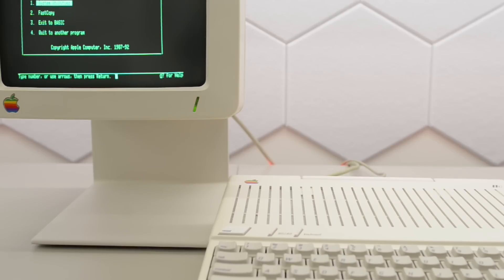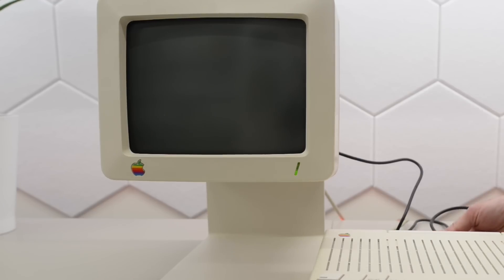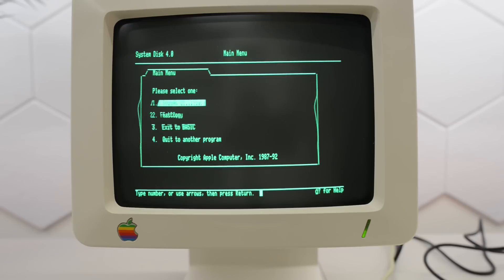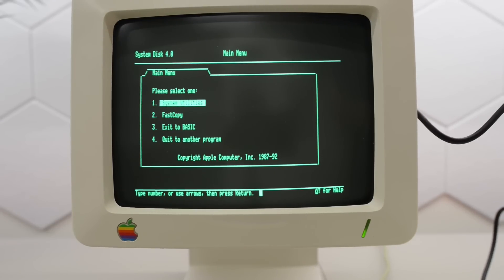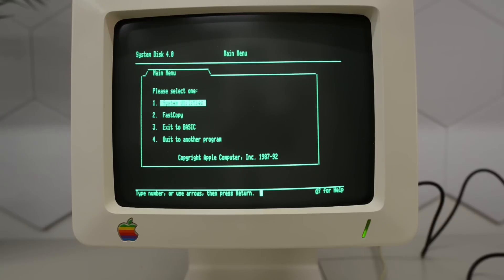Let's start with the simplest thing first. I noticed that the original display cable has connectors that look very worn, so I've got a brand new cable here — very nice and thick. Let's give it a try. Oh, that looks even worse. That's interesting. Now the graphics are shaking even worse than they did with the old cable. Let me twist and turn the cable and see if that makes any difference. No difference whatsoever. I'll move the cable around and see if it's picking up some interference. No, I can't see any difference. I'll turn some lights off and see if they are causing the interference. No difference at all.